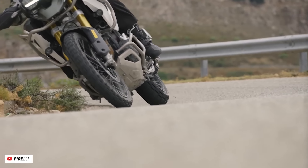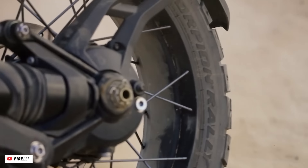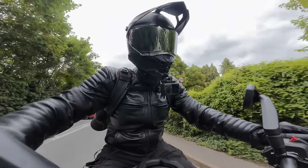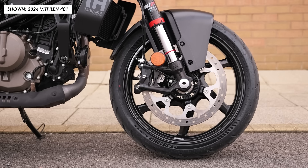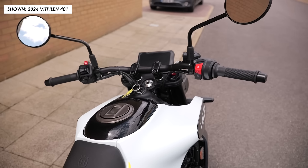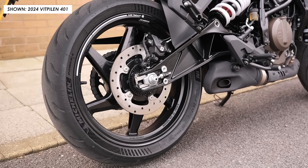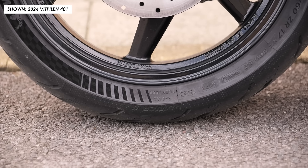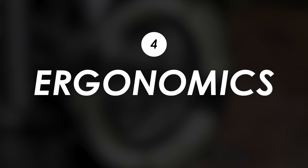The rest of the chassis is built not at all for off-roading, yet the tires are definitely more towards that side of things, so I'd be looking for something a little more grippy to make more of the bike. It might also be a reason to go for the Vitpilen, which I've also ridden recently — it handles a bit better with cast aluminium wheels that are a little lighter, a sportier position, and proper road-focused tires. It's also worth pointing out these spoked wheels take inner tubes, so if you're not comfortable changing tubes for a puncture, you might prefer the Vitpilen's cast wheels, which you can just plug with a bung.